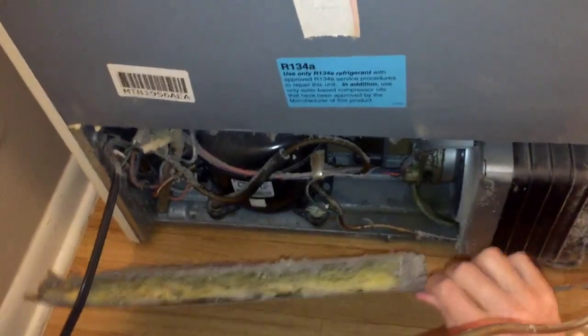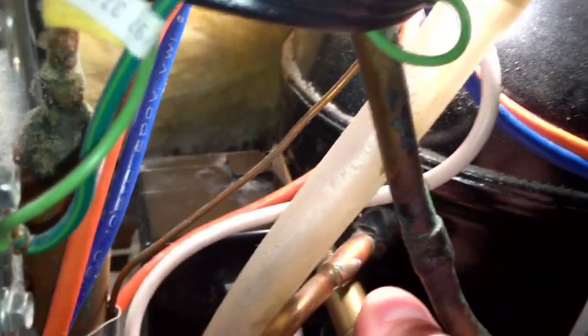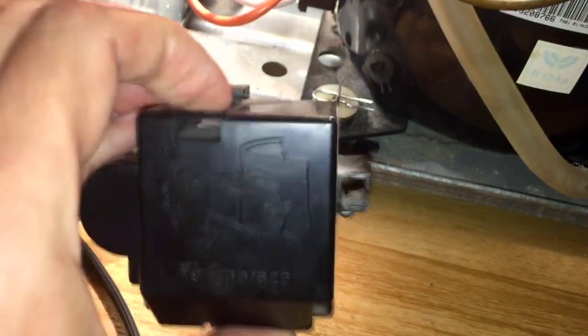To get to the compressor, you need to remove the back panel on the bottom and also unplug your fridge from the wall for your safety. On the side of the compressor, you will see a plastic box cover, which can be held by a single screw, a metal wire clamp, or as in my case, there are some plastic clips inside the box. You can release those clips from the top with a screwdriver and then wiggle out the rest of the cover. You will probably struggle a bit, but eventually it will come off. This is how my cover looks, but yours may be different.